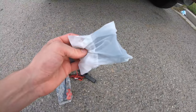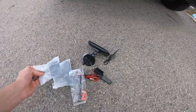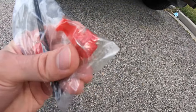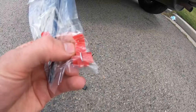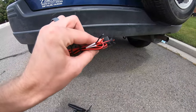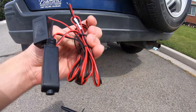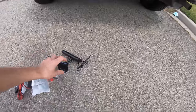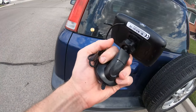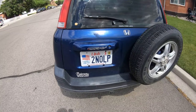You do have to supply power to the camera — there's a little camera lens. A lot of these you have to actually wire to the reverse lights, that way the system powers up when you put it in reverse and the reverse camera comes on. These are nice little connectors, especially for stuff like this. I actually don't mind using these — I used to hate them, just the idea of smashing something into your wires. But I've been using them on my own vehicles like when I installed trailer lights on my truck and I haven't had any issues. This is the other part — I'm going to wire this up underneath the dash and find a power supply that's only on when the key is on. This probably just powers on when it picks up a signal from the camera. And we'll put this up in the front seat — this is just the camera, and this is the little cable that plugs into the USB or wherever you wire that from. This will just mount right up to the windshield. Pretty easy installation and I think it'll give my wife a bit of confidence. Apparently the camera's at a 110 degree angle, which I think they say is like the golden angle for parking to help you parallel park.